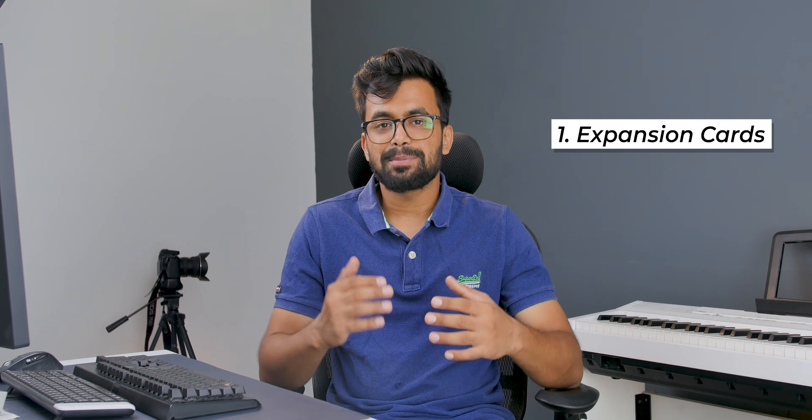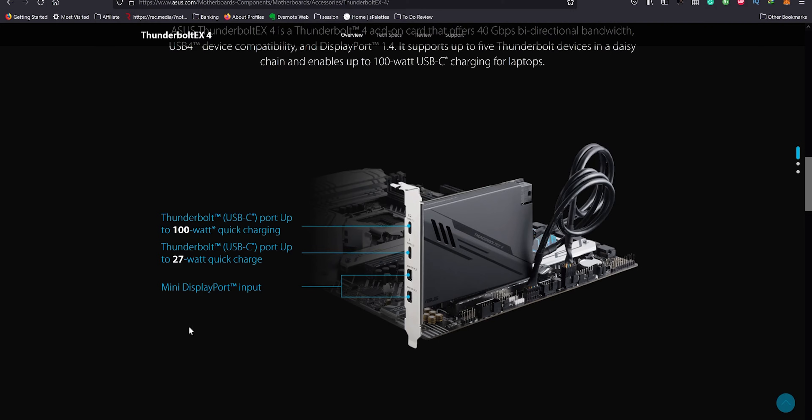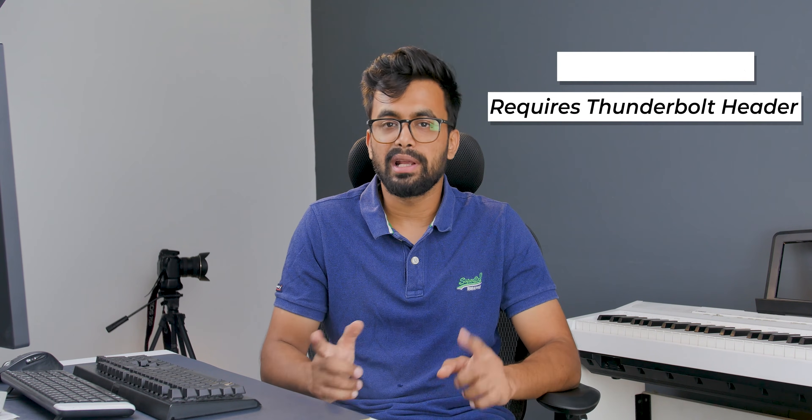To make this work we have three options, each with their own pros and cons. The first is to buy a Thunderbolt 3 expansion card. These are expansion cards for your computer that you can install in your desktop and get a Thunderbolt 3 port on the back — there's one from Asus, for example. You can connect two DisplayPort signals from the GPU and get one Thunderbolt 3 output for the display. This is a great solution for anyone looking to connect a monitor with more than 4K resolution, but it is limited to those on desktop who also have a Thunderbolt header on the motherboard. It's also not a solution for anyone using a laptop.